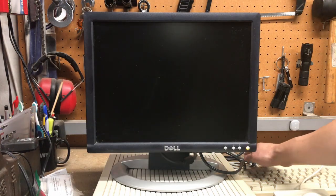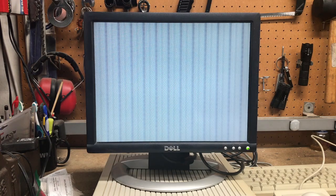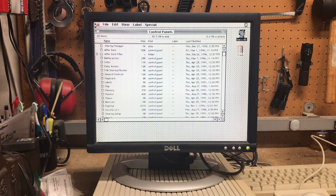One last update: the platters on the hard drive were spinning but the heads were definitely stuck. I wouldn't normally condone opening up a hard drive, but I didn't really need my econ papers from back in the day, and anything critical I would have moved on to my replacement computer 20-plus years ago — so I really didn't have much to lose. This was for education and not for data recovery, and I didn't have a proper clean room, but I figured if it fails, so be it. Sure enough, the rubber bump stops for the head had turned into a really sticky tar-like substance. I ended up wrapping the bumpers in electrical tape so that the contact area was no longer sticky. It turns out these older hard drives are pretty resilient — after the quick fix, the LC booted up from the hard drive. I don't know how long this fix will last, but I'm happy for now. It definitely gives you time to extract data if necessary.